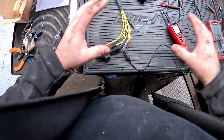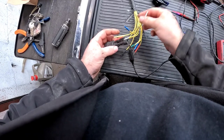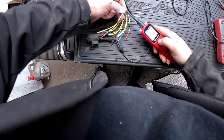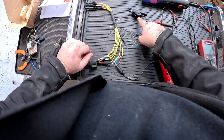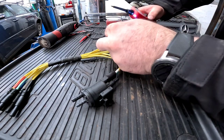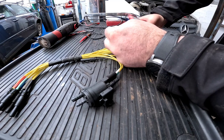You can check these out of the vehicle. If you've got a power probe — and because the pins inside the plug are ever so thin, I've used some breakout leads. We've got green and white, and if I put power to it you should hear it click. As you can tell, this one isn't working. We have got a brand new one here. Now with the brand new one coupled up and power applied, you should be able to hear it clicking. Absolutely perfect.